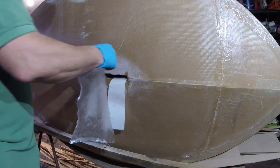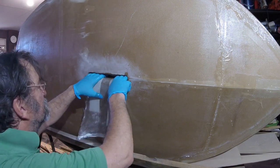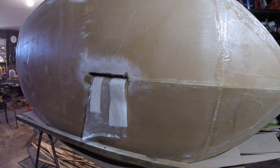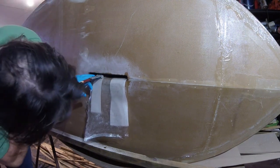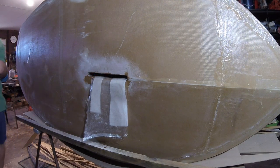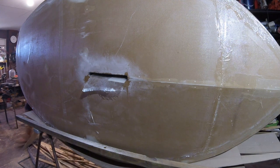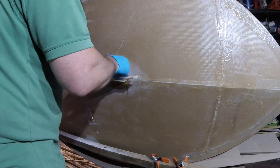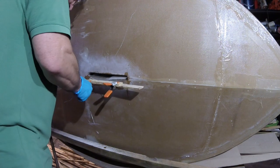I've got these two pieces hanging out both sides of the center case — obviously getting the glass in over a sticky surface in there would just be a mission. The center case is actually tapered too, so I worked from the narrow side to the wide side. I poked the fiberglass onto the bits of sailcloth, and then — I don't use a roller for fiberglassing very often but on this case I did — I taped a stick to it so I could reach the center of the center case, using the roller just to push that fold of glass flat. Then I go around the other side and pull the sailcloth through, and with it comes the fiberglass. Now I need to remove the sailcloth from between the fiberglass and the MDF, so I put two bits of scrap timber with clips on there so that when I pull the sailcloth out the fiberglass — I hope — will stay put.